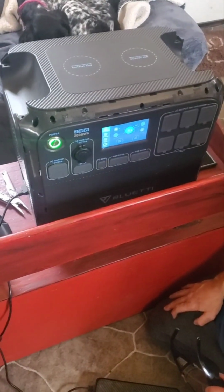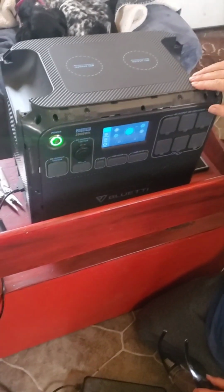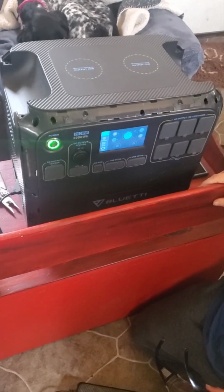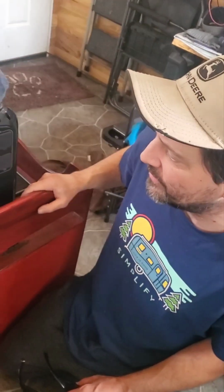Each day we would charge it, and it would only get like 2 more volts added, and we needed to get it to 40 volts before it would even take a charge. So, yay, it worked. We were barely at 40. We were just above 40 volts. You really have to at least get 40. If you have anything less than 40, it's probably not going to charge. So yeah, it's not easy.